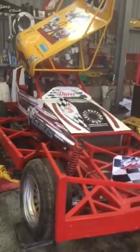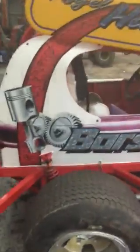Shale car, opposite to that, the engine's a little bit further back, 7 inches further back. Got smaller brakes, 2 pot brakes on the front and back, but this front right is on a lever, so it's actually turned off. So when you're braking on shale, the car pulls to the left and brakes the back end out. So we've got a brake bias lever on this car as well, same as the other car, but this bias is mainly to the back. You've got rear braking, so the car brakes in as you go into the corner, and that's the idea of it.